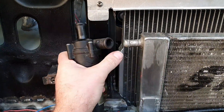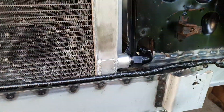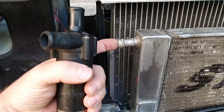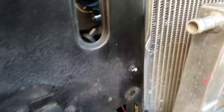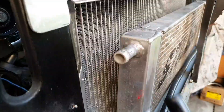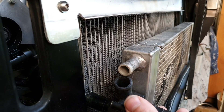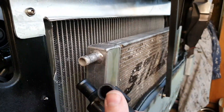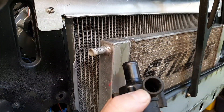If you're watching Facebook Live this morning you would have seen I had thoughts about potentially using the original intercooler pump out of the Nissan March race car. Looked into that because of its size etc. - it's actually not going to be a problem anyway. We do have plenty of room for this pump in this situation. So that's okay, I don't think that's an issue at all. We've got a slightly different size fitting on here compared to there, but that's no issue because we can chop off and change them to whatever we want. I'll lop that off and put a bigger size pipe on there. You can see I barely fit my finger in the end of there - I'd say about a 10mm hole in that, quite a lot bigger in that one.